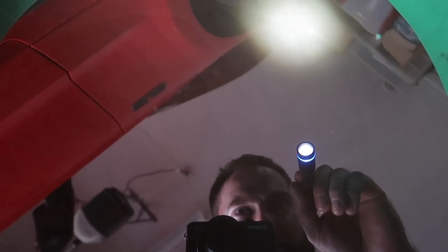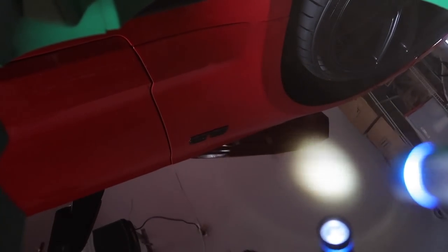All right, we have our engine oil out. We're going to look for any flakes or anything weird. I can see a couple... definitely see a couple. Yeah, it's very flaky. All normal stuff — the engine is breaking in, we just started kind of getting on it a little. Look at that, it looks like a brain! It looks like the first time it came out. It's pretty crazy. A little flaky, a little metallic. I don't want to say super flaky — this is just a little bit milky, a little metallic. I don't see anything abnormal or crazy red flags.